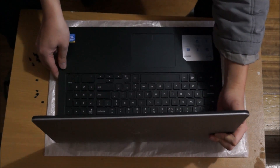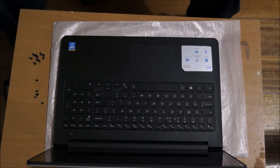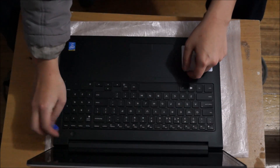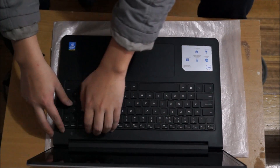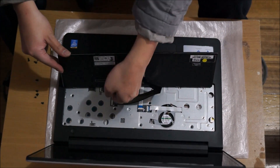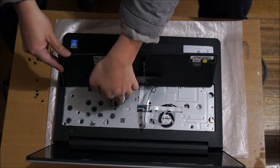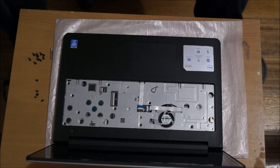Please note for this laptop: once you start to remove things, the LCD screen gets heavier and makes your laptop tilt. You need to use your prying tool to pry the keyboard open from the top and take out the keyboard. Don't just rip it apart, as there are two cables under the keyboard — this one is your keyboard cable, and the next one is your backlighting for the keyboard. There are actually a large number of screws under this keyboard.